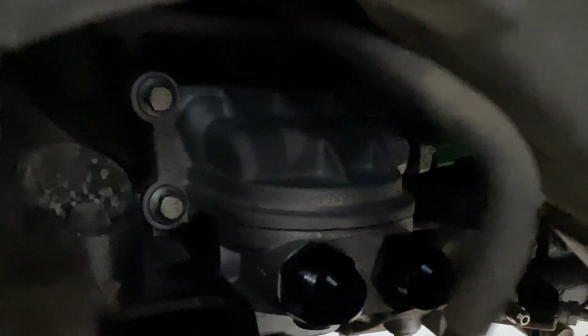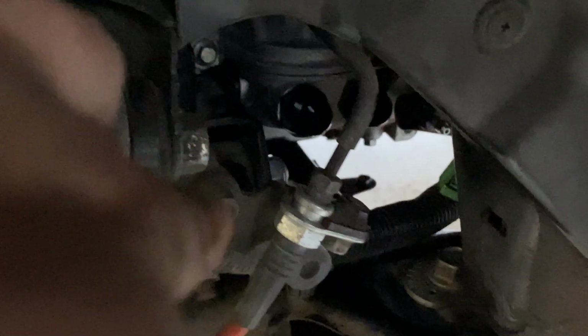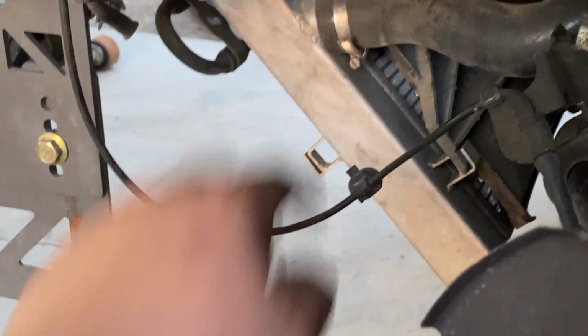Running out of daylight, but I was able to get the whole cooler assembly installed. That's the new oil filter housing, the new Mocal Thermostatic Oil Sandwich plate, fittings, everything's all torqued to spec. And I will continue next with putting the AN lines, routing those over to here, and the oil cooler gets mounted up somewhere in this general area.